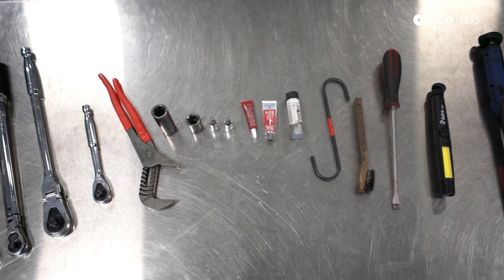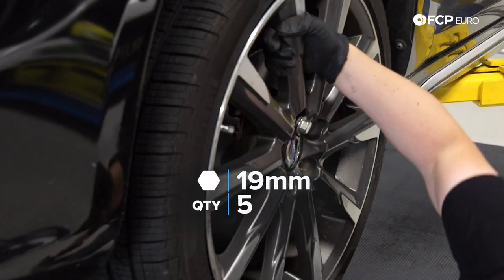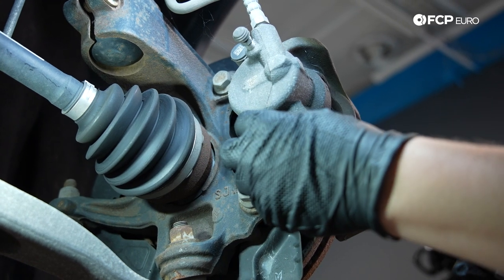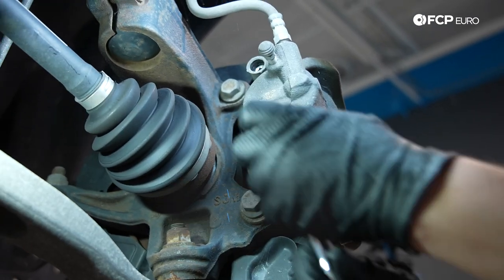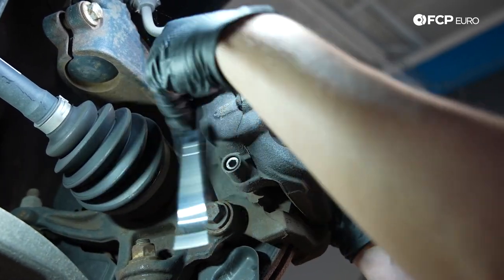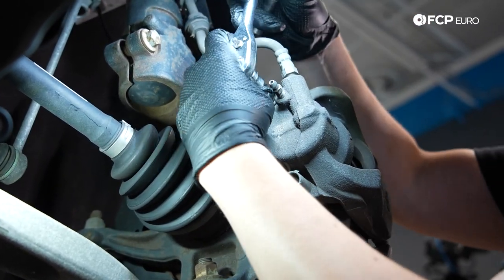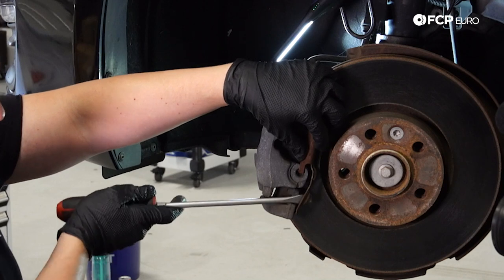Now that we've taken a look at the tools you're going to need, let's go ahead and get started. First thing we're going to do is take the wheel off — they're 19 millimeter lugs if they're still your OE lugs. Now that the car is in the air and the wheel is off, we have a good look at our 300 millimeter brake setup. The first thing we're going to do is take off the guide pins. There are two little dust covers that you can use a flathead screwdriver to pop off, and you're going to use a 7 millimeter Allen on the inside to back them off. Once you feel them get pretty loose, you can almost pull them out by applying sideways pressure. Sometimes they can be a little bit finicky.